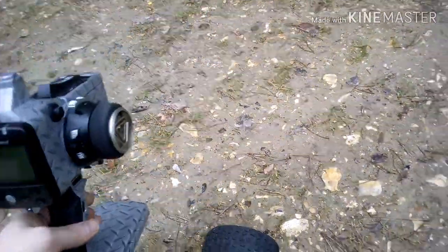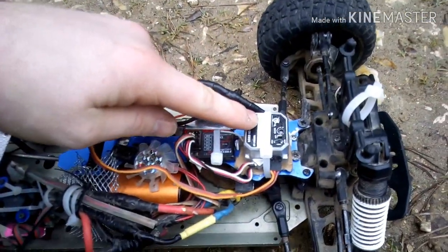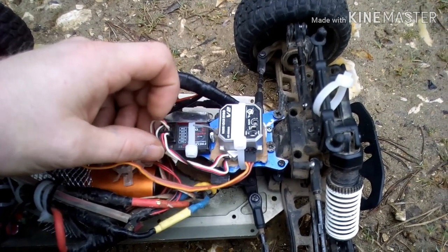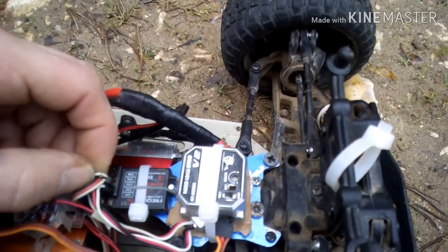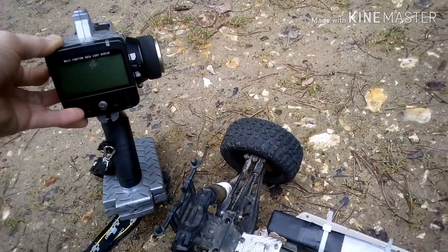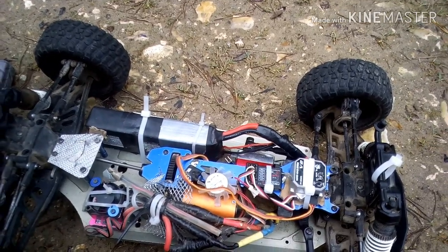You're gonna need a programmable transmitter. What I've had to do is — as you can see — the servo, the Ripmax brushless servo, is going into the head hold gyro, and out of that you've got two outputs. One goes into your normal channel one steering servo input, and the other — you'll see I've stripped back the red and black wire — is just a signal wire going into channel three. To get this to work properly you need to go into your sub trims on your transmitter and go to minus 100 on channel three sub trim, which seems to be the sweet spot for me.